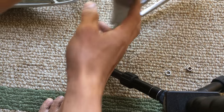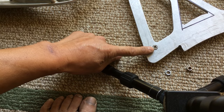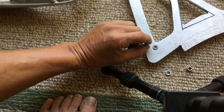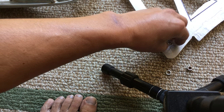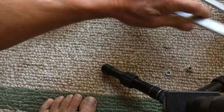The main thing is you have to use countersunk screws because the top box sits pretty much flat against the plate — there's probably only a millimeter or two of space. You can't have a bolt head or nut head protruding, otherwise the top box won't fit.